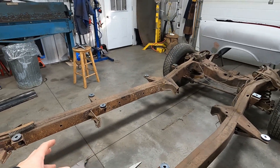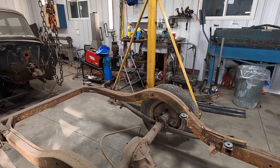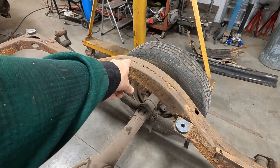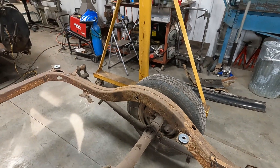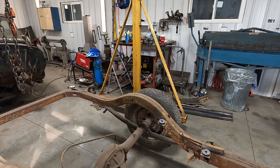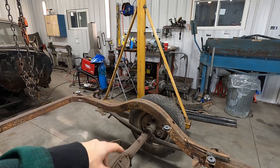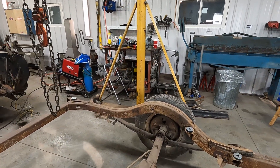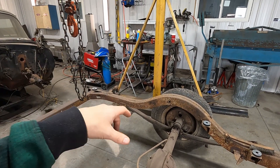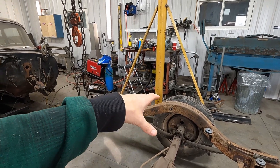I need to go over the frame front to back and make sure there's nothing I need to fix. On a quick look I haven't seen anything major — it's a seamed frame and I see some rough spots up there, probably crappy factory welds, so I might weld that up a little bit. One thing I am going to do is put a brace in across — whatever I do for my suspension, I'm going to put a brace across so the shocks don't go into the floor anymore; they go to a brace.